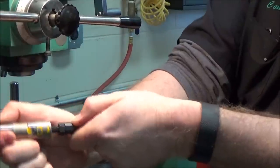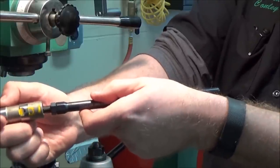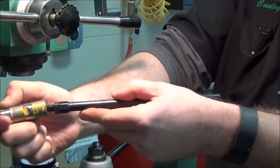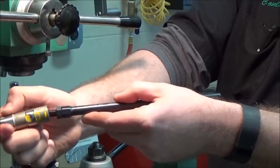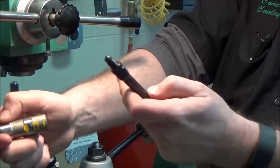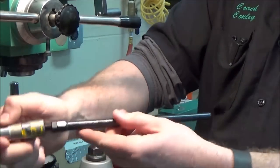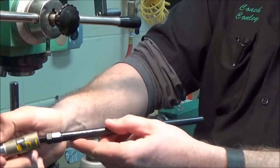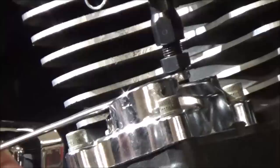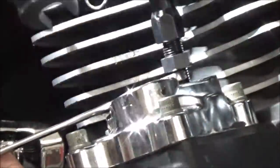A good question: what's the starting point? You'll feel a little bit of a cushion in there — that's zero. So it's two and a half turns from wherever zero is. On one valve it might take you three, four, five, even eight turns to get it to zero, but it's measured from that point. This is all set on top dead center compression of that cylinder — you have to be on the correct cylinder's top dead center compression.